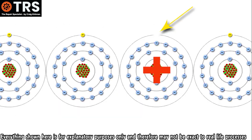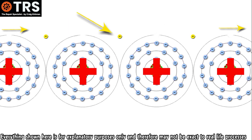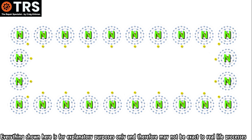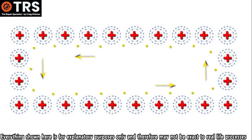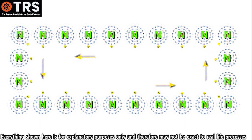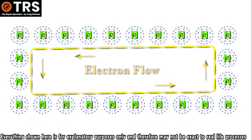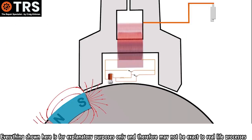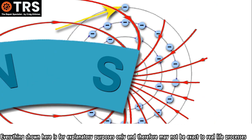It's now clearer to see that whilst an atom is in a positive state as an ion ready to accept a negatively charged electron, the system is ready to provide that because there's a flow heading its way — that negatively charged electron is pushed across to it by the one before it. When we move electrons across it causes that chain reaction, all those electrons move in one direction, and this is what we call electron flow — the electrical current. To keep the flow going, we keep providing the stimulus by repeatedly passing the ignition coil with the fixed magnet on the flywheel.